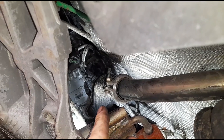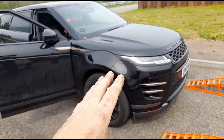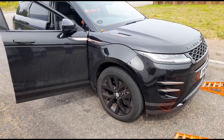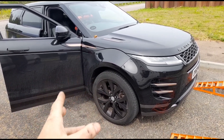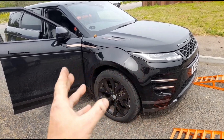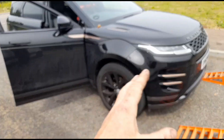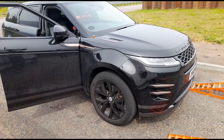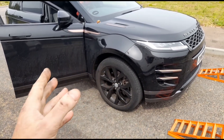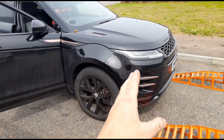All I can see so far is that the DPF pressure on revs is slightly too low — not massively, but slightly under the numbers for the DPF, so it looks like the DPF is damaged, which is common on these anyway. I haven't seen the P2292 code before — it's a similar code to what you get on Audis that blocks the EGR cooler. Usually on these you'd get a P049B code. This is a newer model which has changed slightly, but I don't think it's the EGR cooler.